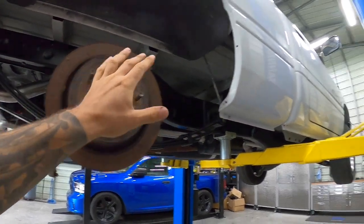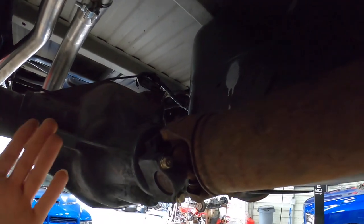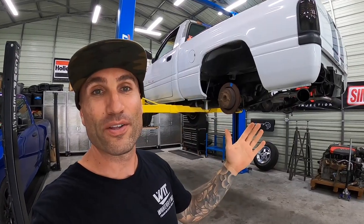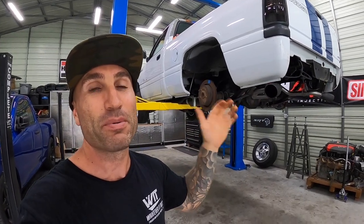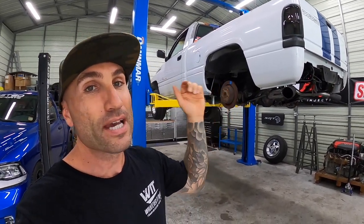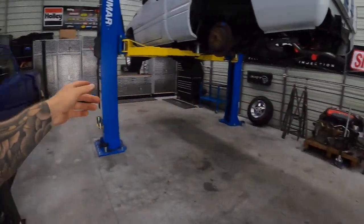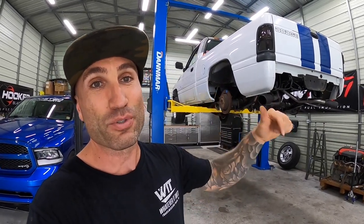You're going to need some new lug nuts — whether you decide to match the front is up to you. Also, the ABS sensor: I was actually able to plug it right in and it clicked right into the third gen axle connector. If yours doesn't plug in you can swap over the sensor — it's just one bolt and it pops out. I hope you guys found this helpful. If you did, give it a thumbs up. Any questions, ask down below, and thanks for watching.